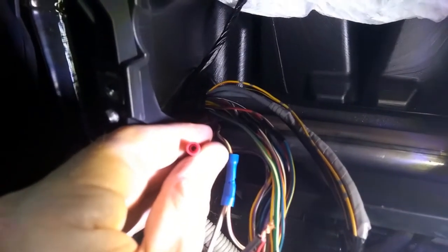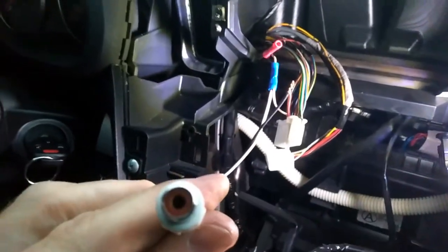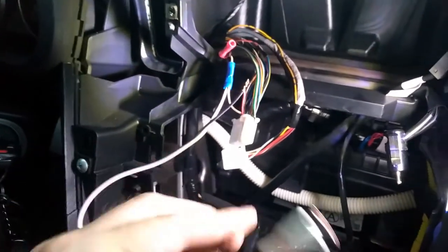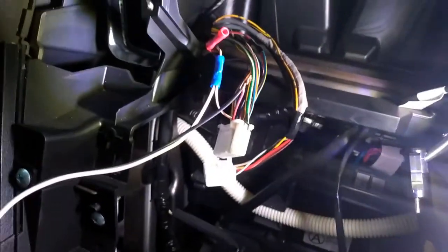crimp them properly. So I use the pliers, see, long, and I just attach the cable to one and pressed on one side. Now I'm gonna do the second side, pushing cables there and doing the same. I already did this here, seems to be holding nice, cables are not pulling from there, so hopefully it's gonna hold, so I will follow with the next cable as well. And I plugged that, as you can see, I made the cable, it's that RCA, so center goes on plus, and shield from this cable goes on minus signal on the left rear speaker.